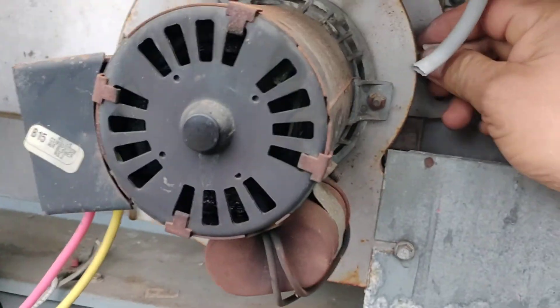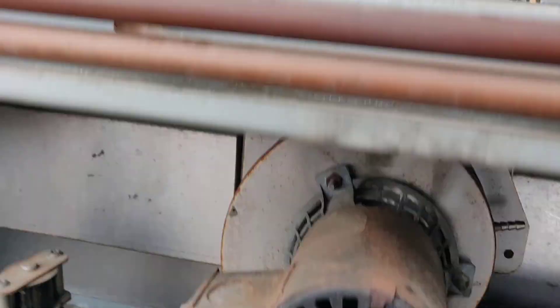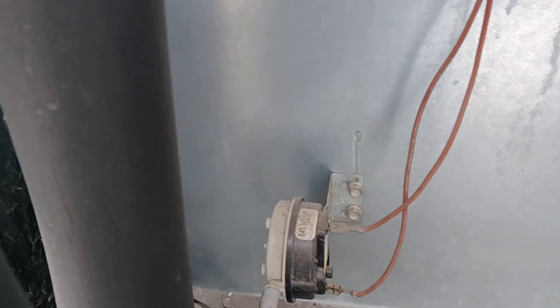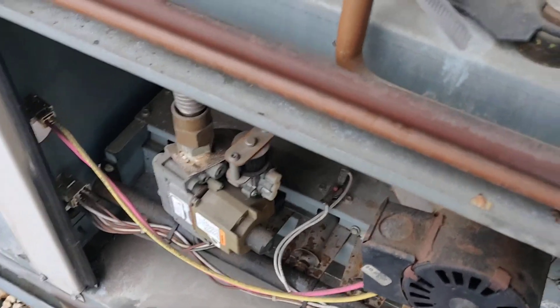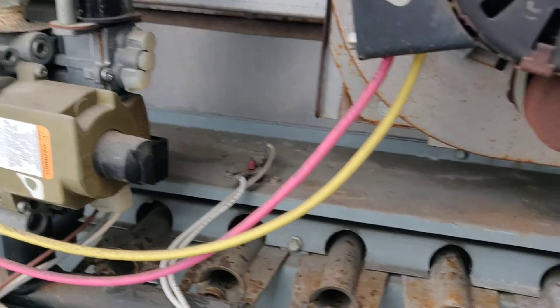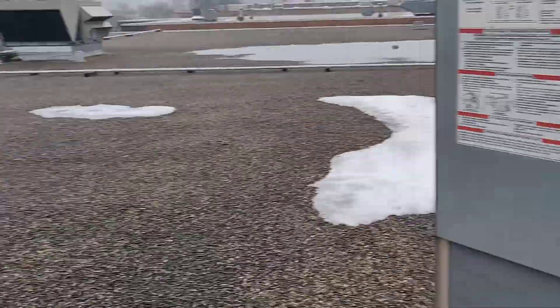Take a knife, cut the little piece out — you still have enough hose to reconnect. But now we've got to make sure that the pressure switch opens and closes too. That's a good sign right there. Plug it back in, let's restart the unit and see what happens.